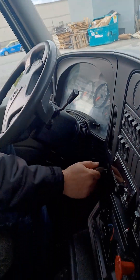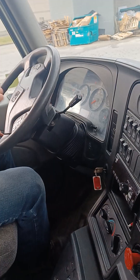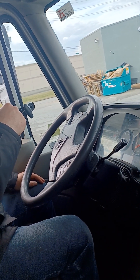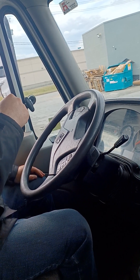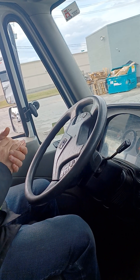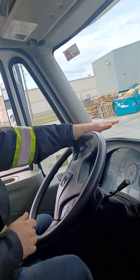Dashboard on, engine off, both buttons in. I'm just gonna wait for my air pressure to stabilize. It's almost there. My air pressure is at 103 psi. So what I'm gonna do is go mark my push rod stroke on my trailer, because my truck has hydraulic brakes — or it has disc brakes.